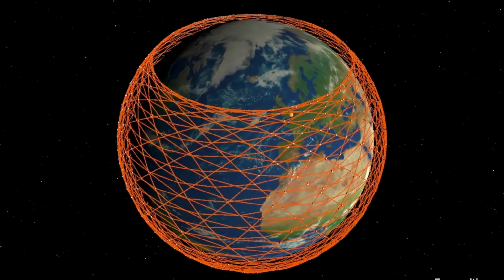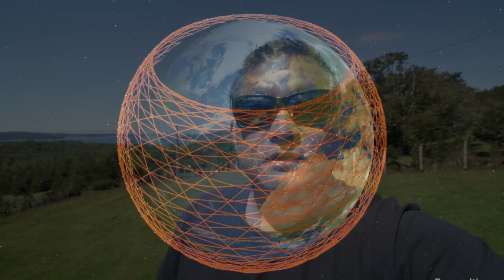And the reason why they make you do it, at least this is my suspicion, is actually about load balancing Starlink satellite loads. Because they have a fixed number of satellites up in the sky, as they fly around the Earth, they are only able to output a certain amount of maximum data. So based on the amount of people that are using the Starlink dishes, the Starlink satellites at any given area, by telling users to point and tilt their dishes in a certain way, they're able to load balance their actual capacity. So that's why I believe that they ask you to tilt and rotate your manual dishes, but even if you don't do it, it will still work.